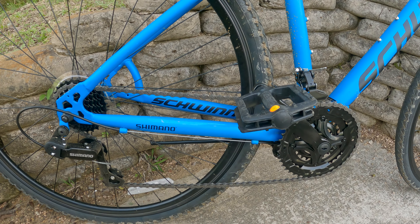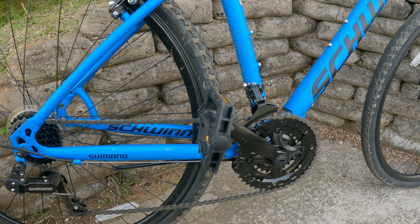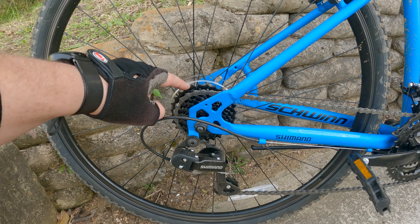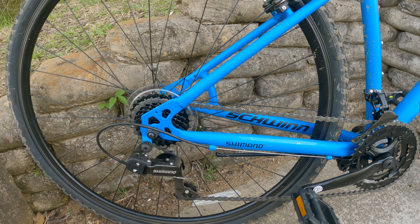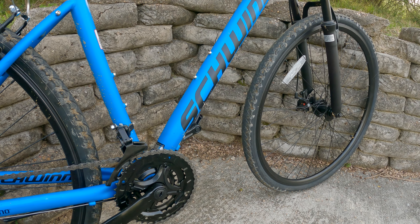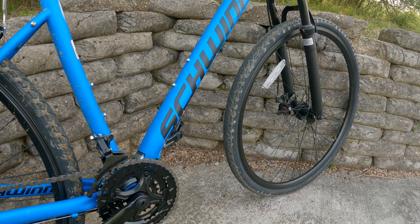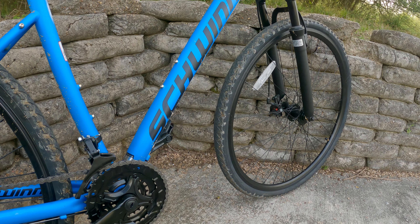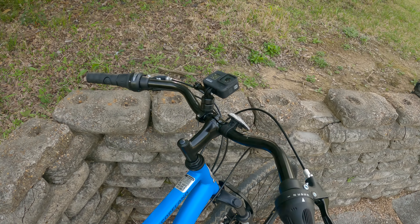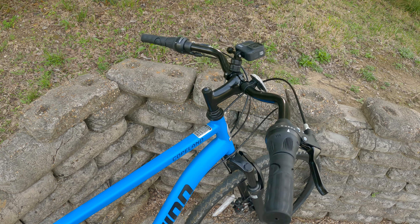This bike does have a lot of room for potential upgrades. Some things I can do right away: replace the pedals because these are plastic; replace the crankset, maybe make it a one-by and put a mega-range freewheel on the back — that will solve the gearing issue. Brakes can be adjusted and also upgraded to entry-level Tektro or Zoom, or anything hydraulic, and it'll give you much better stopping power. You can find just the front brake by itself for a relatively very low price. And the handlebar can be upgraded really easily — the adapter I got was like ten dollars. If that's something you want to see on this channel, let me know.